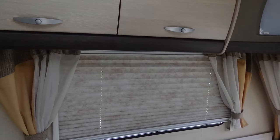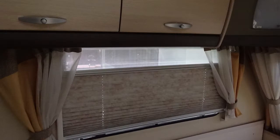Your caravan windows are very important — over a thousand dollars for each window — so it's important that you look after them. We tend to pull the blinds down when it's sunny, but this creates a heat buildup between the back of the sun blind and the window, and that heat starts to break the windows down. It is recommended that when you pull the blinds down to keep the light out, you leave an air gap at the top which allows the warm air to escape inside the caravan, and it won't damage your windows.